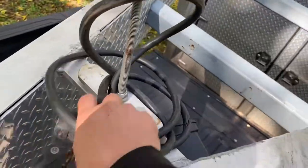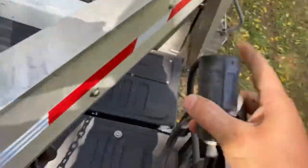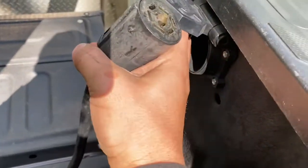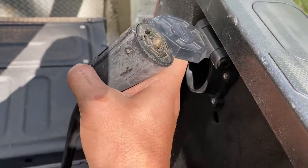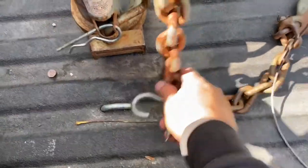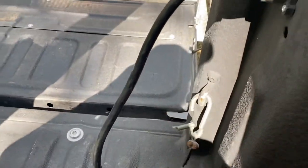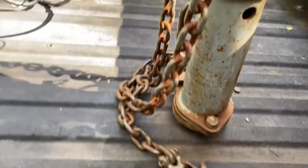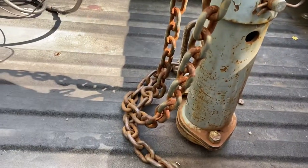Now take your lights. Some of you might not have a connection point in the back of your truck, so you will have to put it on the bumper. According to USDOT, it is not to be connected at the same point as your safety chains — I put mine on this loop back here. Connect your safety chains to the safety loops provided and crisscross your chains according to USDOT.